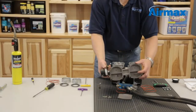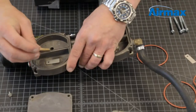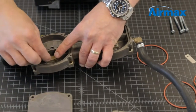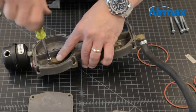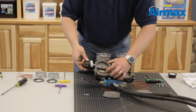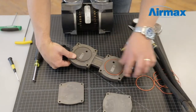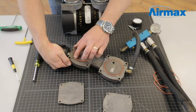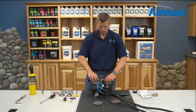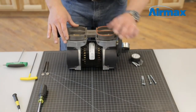Once complete, flip the cylinder head over and repeat the process for the other two leaf valves. When installing the top two leaf valves, note to reinstall the leaf valve retainer with the curved portion resting on the leaf valve. Ensure all four leaf valves completely cover the holes. Next, install the two new o-rings from the maintenance kit onto the bottom of the cylinder head. Flip the cylinder head back onto the cylinder and push down firmly to secure into place. Then install the two new gaskets from the maintenance kit onto the top of the cylinder head.